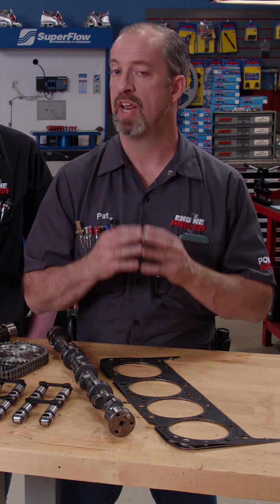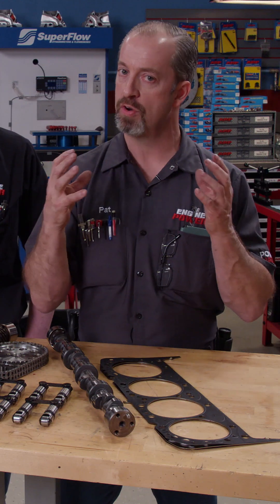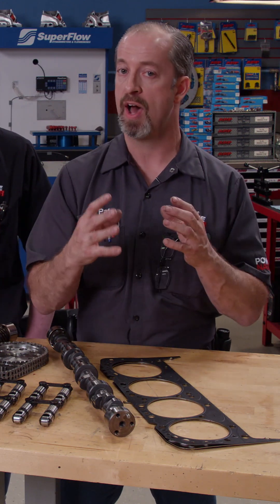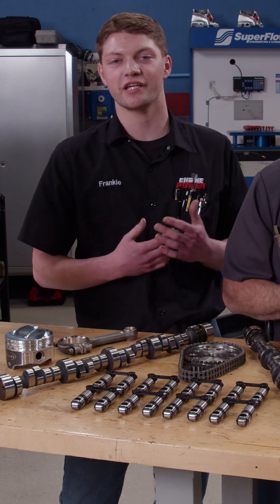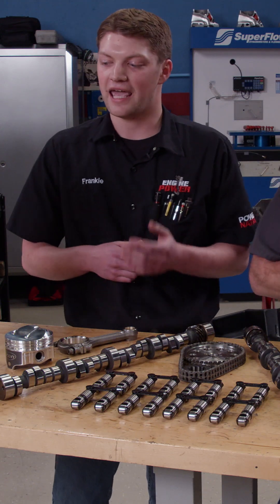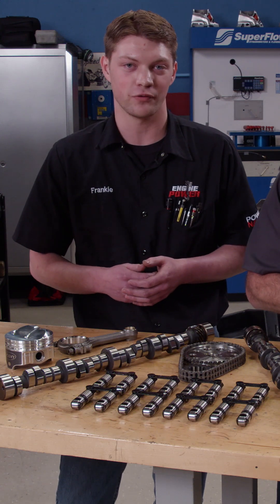That is a large equation, and if you're good at trigonometry you can figure it out, but if you know all of your numbers you can plug them into a few online resources and the math will be done for you. When we built our engine in the parking lot, it had a measured static compression ratio of 8.82 to 1 and a dynamic of 7.27 to 1. Now with our new parts — our 13cc effective dome, our head gasket size, and our head chamber size — we have a measured static compression ratio of 13.15 to 1.